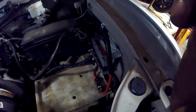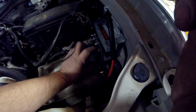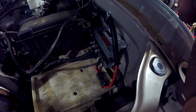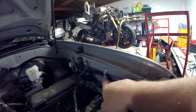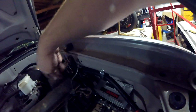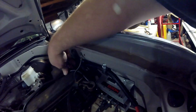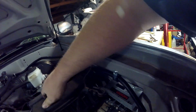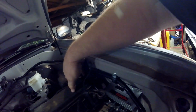The main one that can never short out, guys, cannot happen, is this one. You cannot let that short out, okay? You have big problems if you do that. But I got my protector all the way around. I used a couple of these little rubber coated clamps, ran the wire back between the fuse, so that way we got access to our fuses if we need to work on stuff on the side of the road. You know, it's 3 in the morning at a truck stop somewhere and you're trying to get something done.